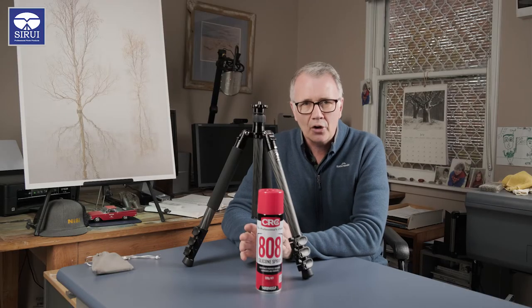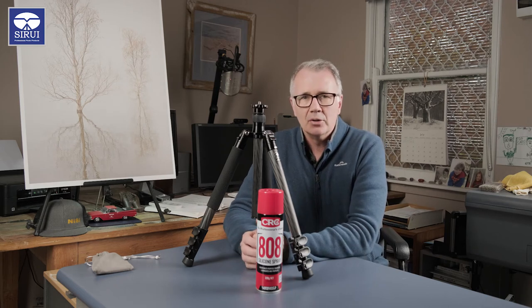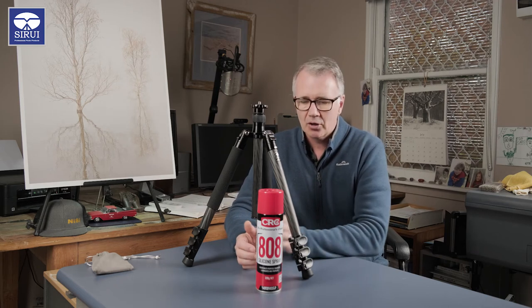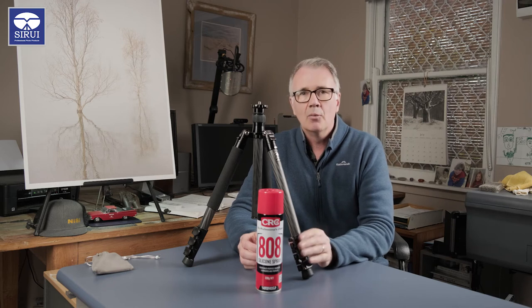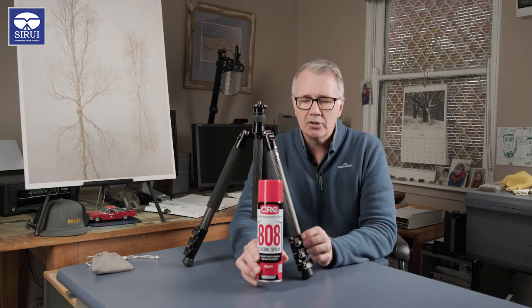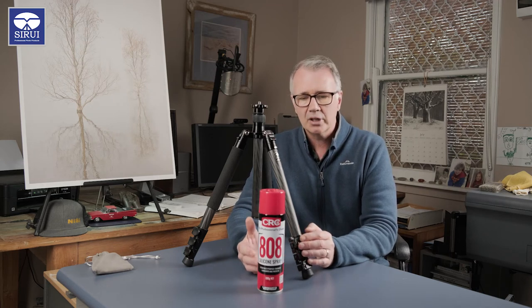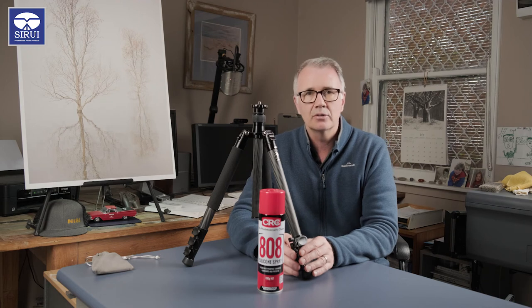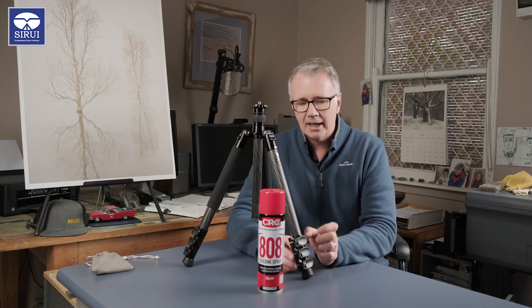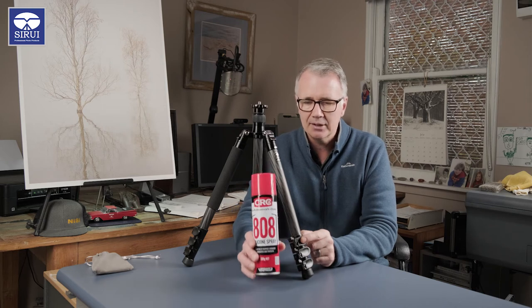Okay, so sorry, we're not quite finished yet. One more thing I want to share with you. I know there's probably plenty of you thinking, can I spray anything on here to help protect it? Well, yes, there is. You can use a silicone spray. Now, don't use anything else. Don't use WD-40. The problem with WD-40 is that it's just going to wash off with water anyway. And the other thing is WD-40 is not compatible with plastics, where this is.